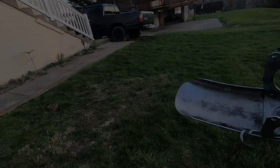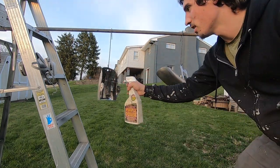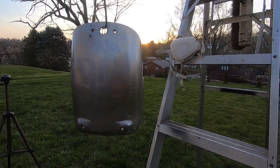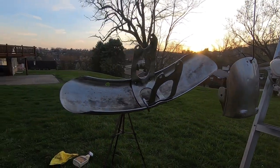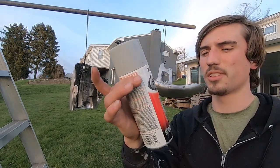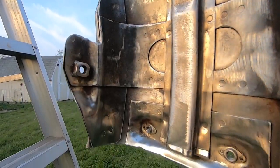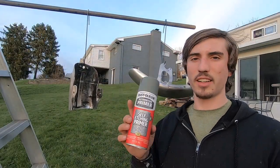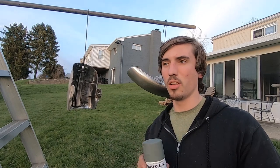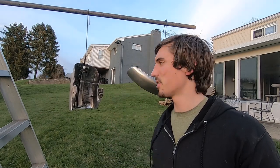Ready for paint. I've got a new microfiber cloth, some paint thinner, and a spray bottle. I'm going to spray these parts down, wipe them off, let it dry, and then hit this stuff with some primer. I'm going to be using this rusty metal primer — it's great for spots where you just can't get all the rust off, like the underside of this rear fender. And for everywhere else that I did get the rust off, I'm using self-etching primer. This primer is great for painting bare metal or previously chromed metal. Self-etching primer etches into the metal and creates a great primed surface.